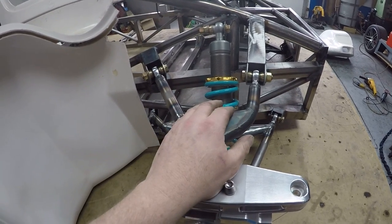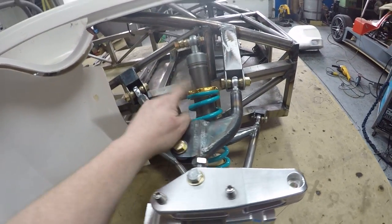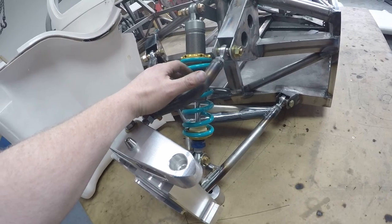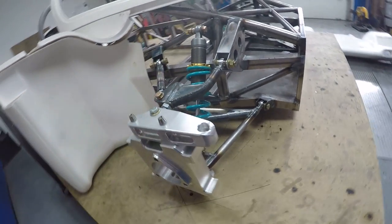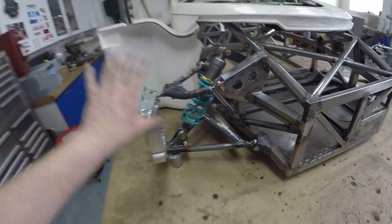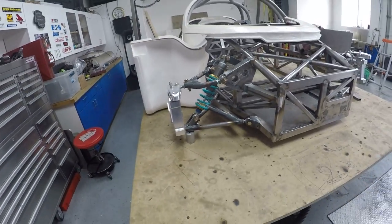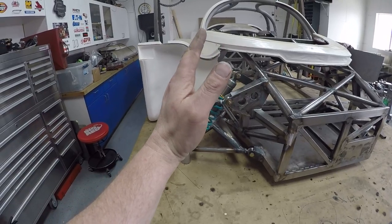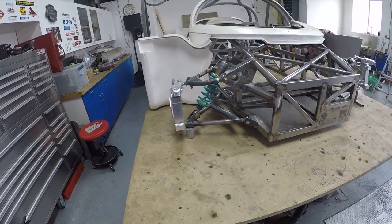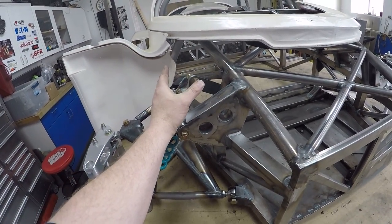This shock is currently upside down - we're going to fit hydraulic lift rams on these shocks, which is another reason I wanted to mock this up carefully. This is a seven-inch long spring and I'll probably have to go for a six-inch spring for this car. The shock actually has about 10mm more travel than we need. At the current angle we have about 65 to 67mm of shock travel. If you bring the shock more vertical you get more travel, which makes it easier to control the rate of change - but I can't do that because the body is in the way.